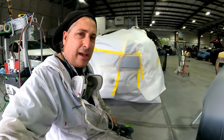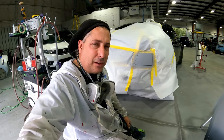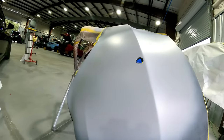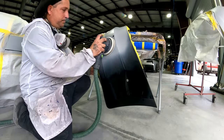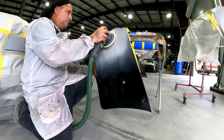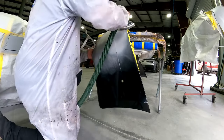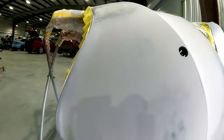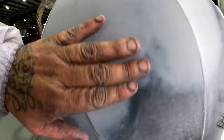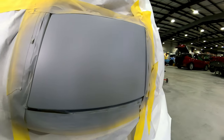Now we're going to hit it with the DA. We're using 600 grit on the Festool — that's the vacuum sander I'm using at this new shop to keep the dust down. There's no trickery here, we just got done blow drying it and now we're hitting it with the 600. It's nice and smooth and you can see it's not powdering much because of the vacuum, but there's a little bit of powder on it. This stuff is definitely one of the best things PPG has.